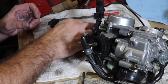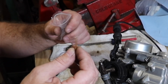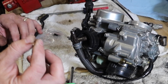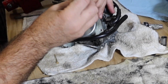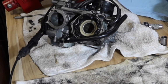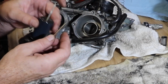There's this little bitty gasket. There's a bunch of O-rings. And I imagine if I take apart the entire carburetor, I will see those O-rings. I'm gonna put the Welch plug cap in here for now. This basically goes right into that main jet on the bottom side of this rubber cup. So we're gonna take that out, see if that's replaceable, and get a clean one installed. Oh, there you go. I thought it was more stuck than that. Let's gently pull this out. Grab the center cup, and then that right there is the placement needle I was talking about.